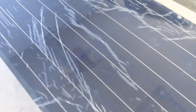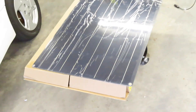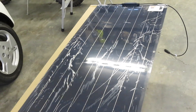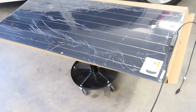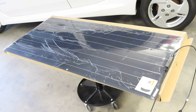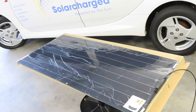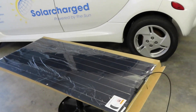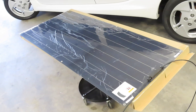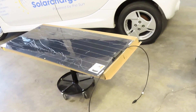There are a few mounting options I saw from people who install solar panels on their RVs — some went mild to wild. I'm going to keep it simple and just clean up the roof of the iMiEV. I'll get a set of good two-way tape, probably from a body shop, and set the panels on with some vents underneath for airflow to dissipate heat. The car is white, so I don't anticipate a lot of heat buildup, and it does sit in Alberta which has cooler temperatures in the fall, winter, and spring.